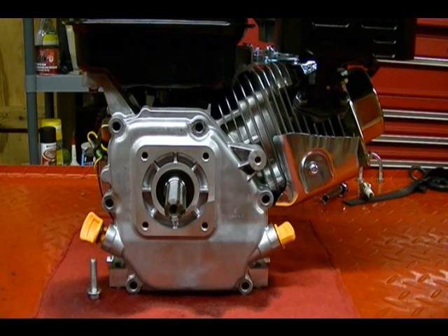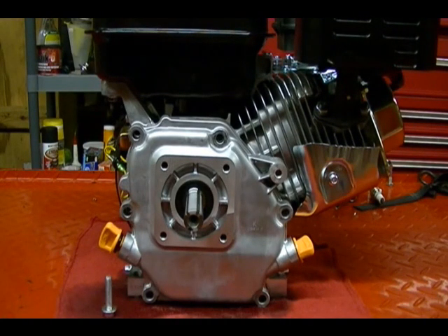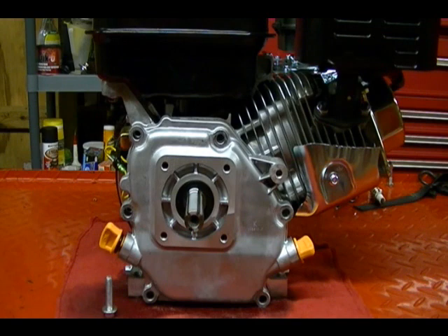That's not a problem if the Rokon is a pre-1994 model running a 2-stroke engine. But if it's got a 4-stroke engine, it's a problem because of the way the lubrication system works. Both the Honda GX160 and the Kohler Command engine use a splash-type lubrication system — meaning there's no oil pump and no oil pressure. It's just a reservoir of oil inside the engine that gets splashed around to lubricate it.